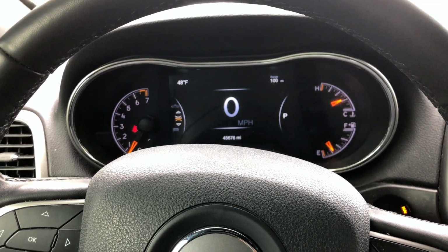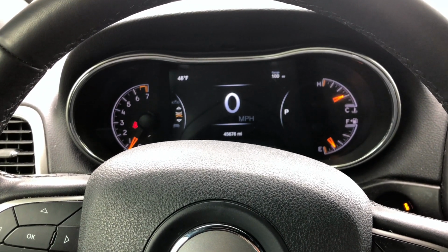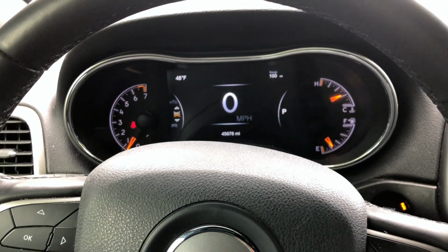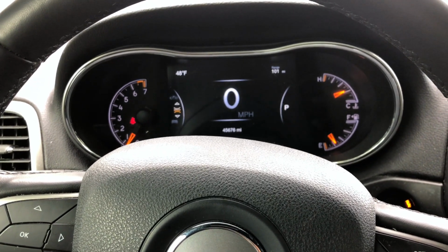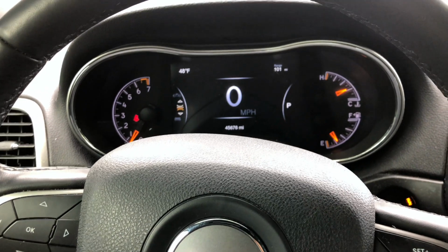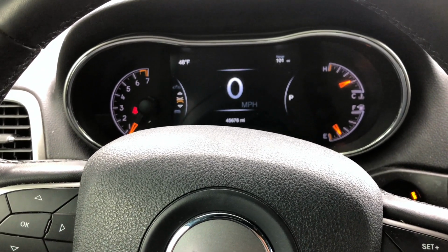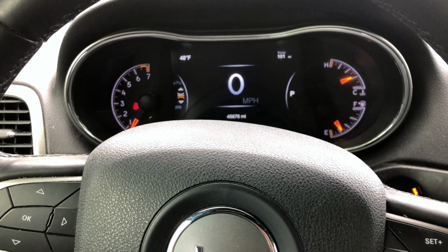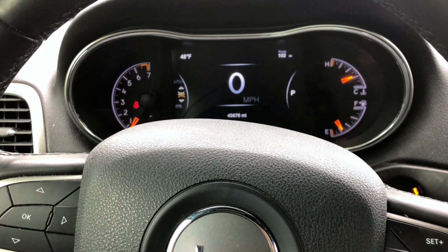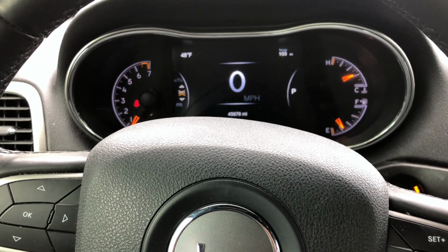I didn't go with K&N or any of the other ones with the open element because of heat soak, or what they call it, when the engine is hot and you've got an open element air filter, you're sucking in all that heat. You don't want to do that because it lowers your numbers. It's pointless. It sounds better, louder, but you're sucking heat into the engine. You want colder air in the engine.